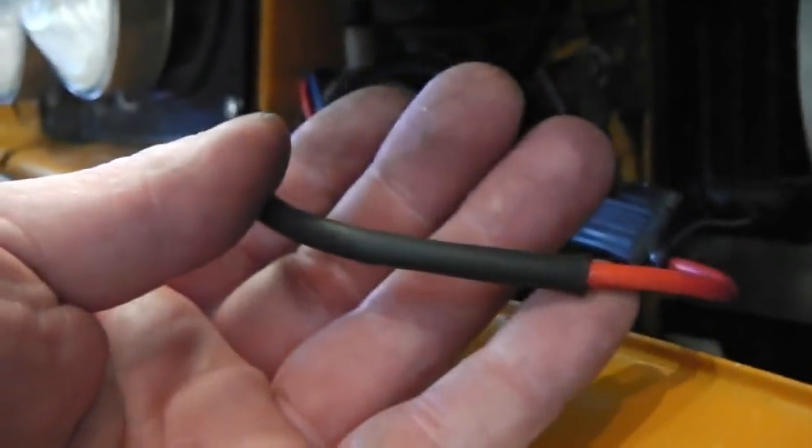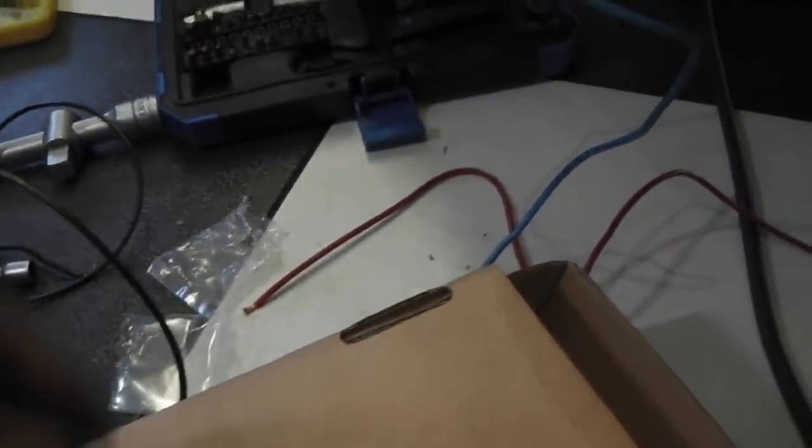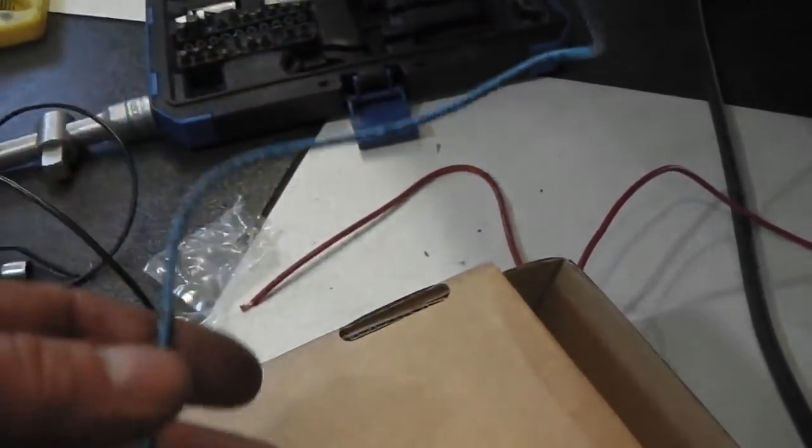And that's going to the relay, which comes with a controller kit. Relay's just here. I'm going to reach in and grab it for you. That's the control relay. That then gives an output on this blue wire, which then connects to the other plug here, and that feeds the 12 volts into the fan. So really this just switches 12 volts off and on with the temperature. So that goes in. Then we can hook up to the fan connector there.